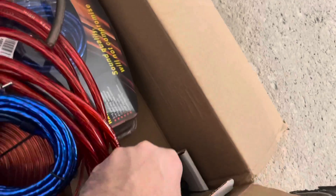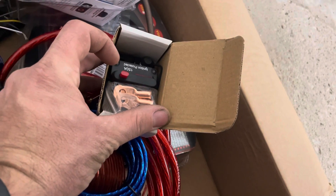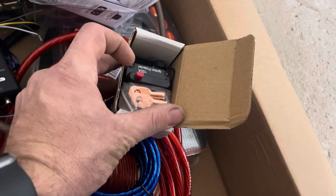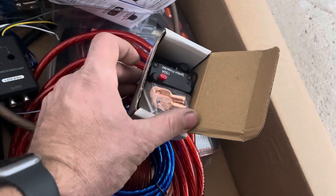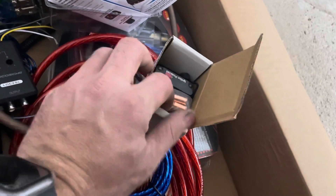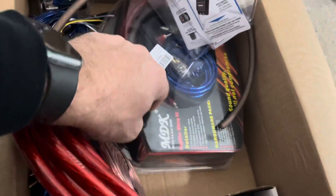One of the other things I got — I paid 25 for it — is a fuse block. I'm not sure how good it is; I bought it off Amazon. It's 150 amps. The reason I chose this one over a 100-amp unit is because my stereo subwoofer amp is around 3000 peak and 1500 RMS — that's the real wattage you want to work from. This protects your wiring and your system from burning down because you connect this right up to where the battery is. I got two of them because they were on sale, and if you look closely you'll see that this stuff is old — the other one had disintegrating plastic, but this one actually looks pretty decent.